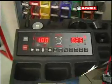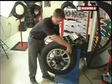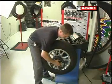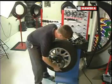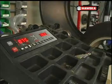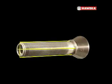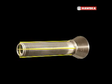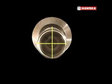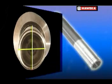When we do a check spin on back or front cone mounted wheels, the balancer sometimes calls for more weight. This is especially true if we dismount the wheel from the balancer and remount it, or if we simply turn the wheel on the balancer shaft. Why does this happen? Sometimes it's simply due to worn parts. The cone and shaft on any balancer wear out over time as a result of repetitive friction between these two parts. The hole in the center of the cone gets larger and the shaft gets smaller, creating an off-center mount.